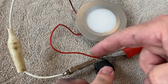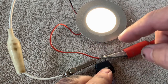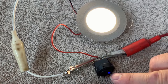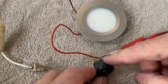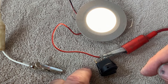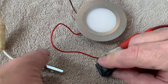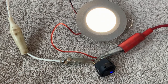Power runs into the switch, and with no power coming out to the appliance, as soon as I turn the switch on, it closes and power gets to the light. The ground from the light goes back to the battery. The third connector here is just providing a ground for the indicator bulb inside the switch. I can disconnect this and still have the appliance working, but the indicator bulb won't light up. We may do that on certain appliances — for example, USB connectors you use at night for charging cell phones, so the indicator light doesn't stay on all night. However, for overhead lights, I'll probably leave the indicator connected so there's a visual indication of which switch is currently active.